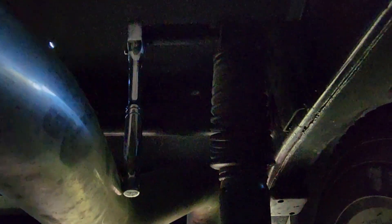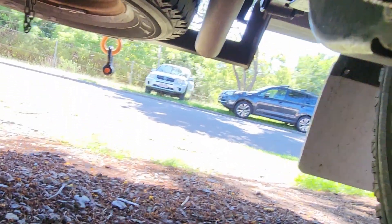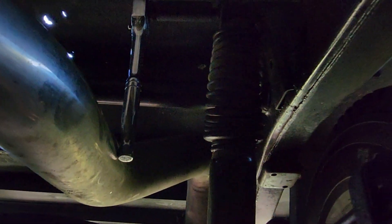You can see I'm up there with a 17mm already taking this nut off. You might need one to hold the back - it's actually got a stopper to stop the nut from moving. So yeah, 17mm up there, 17mm down here. Always chalk your wheels. You just knock this bolt holding the bottom of the rear shock out.